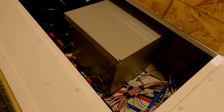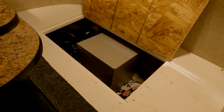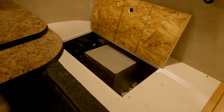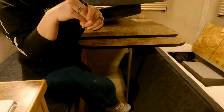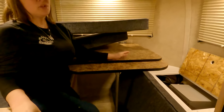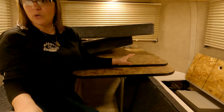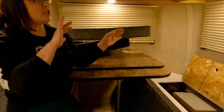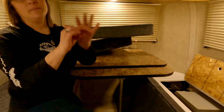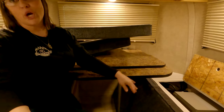In there is your on-demand water heater and your 25-foot power cord. There is also a converter in there — that's the silver box. Now there is a plug just like these black ones that the converter is plugged into. Sometimes when you're pulling that power cord in and out, it might unplug the converter. So if you get to where you're going, pull the cord out, plug it in, come in here and you have no 12-volt — none of your lights work — check the converter. Plug it back in and you're good to go.